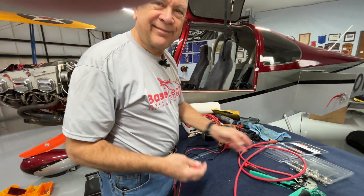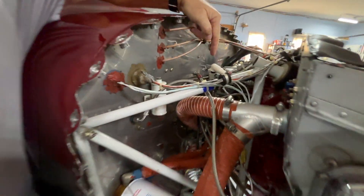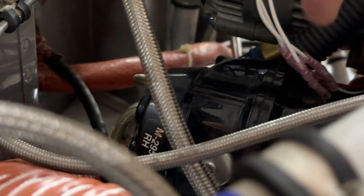The other side of the ignition on my aircraft is a magneto. Some people run dual electronic ignitions, but I'm not comfortable doing that yet. If there's smoke in the cockpit I'd like to be able to kill the master switch, sort out the smoke, and not worry about the engine. So I carry a magneto on one side. We're at 1,100 hours on this aircraft. The magneto installed is a Slick 6350 — a non-impulse-coupled magneto — so we need the electronic ignition for starting. For those with impulse-coupled mags on six-cylinder engines, there's a 250-hour inspection requirement.